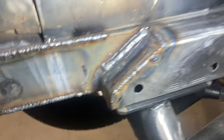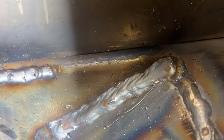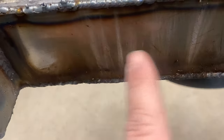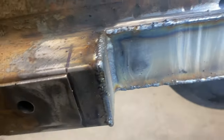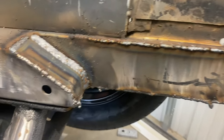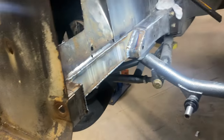So, I mean, this front little area right here, that's what I was able to TIG, and then it just kept getting crappier and crappier. You can see all this white stuff. That's just stringing everywhere. So I said, screw it, and I MIG welded it. I didn't film, I just got busy. I'm gonna grind all this off so that it looks presentable. I'm one of those type of welders, but, and then I'll get the engine set back in there and we should have zero problems now.